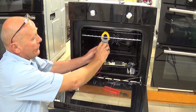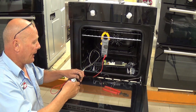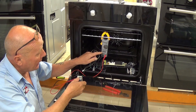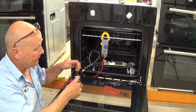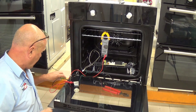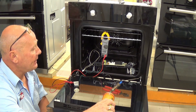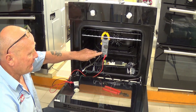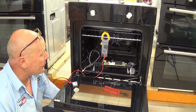We've got the conventional thermostat set up here. I'm going to set the meter to continuity and connect the two probes to the two connections on the back of the thermostat. As you can see, no circuit. Turn the thermostat on and we now have a circuit — set at a temperature of approximately 50-60 degrees. Now by using my blowtorch and applying some heat to the sensor, it has now clicked out, meaning it's not sending electricity through to the element.